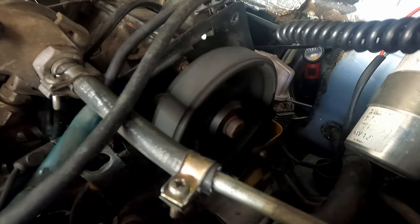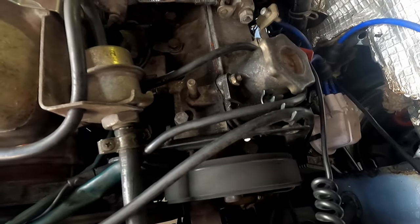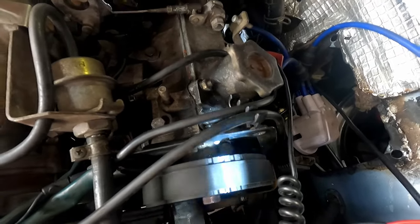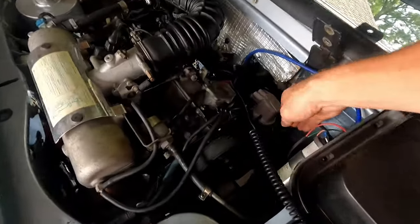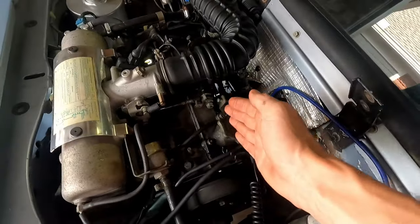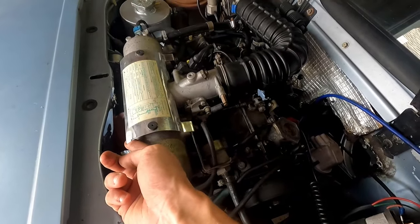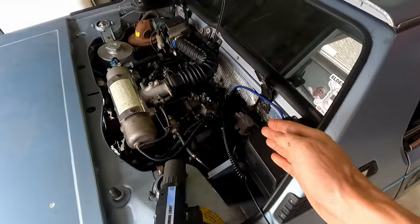Oh yeah, right there. See if I can get you guys closer. I don't know if the frames are going to match the way that this is spinning, but you should see those white lines almost match up, which is exactly 10 degrees, which means it's going to be running so much smoother. And you can tell as soon as we adjusted that timing just a little bit, it got better. Yeah, much, much happier. And you can see we're not getting a lot of vibration or shake, just a little bit here from not having any back support. But it's nice and smooth, and it sounds way better with this minor adjustment.